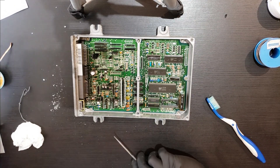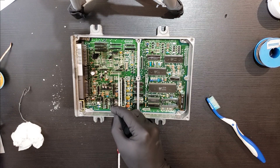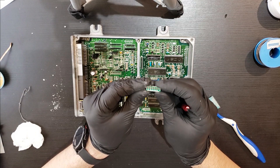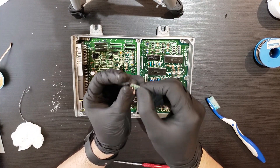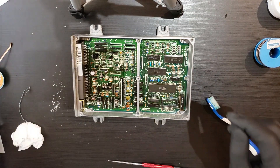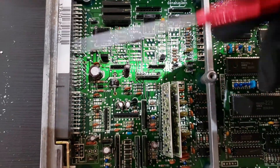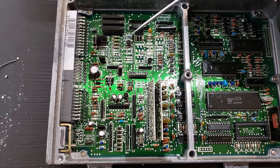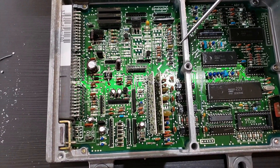Now for the last piece — the RM11 resistor board. From left to right there are three points plus one final point that need to be connected, and the resistor board is also marked one, two, three, and the final point — four points total. This is the first time I've seen one of these resistor boards. It comes with pins, so you install and solder the pins on, then seat the board. There you go — the RM11 resistor pack is installed. So all components are done: D11 diode, IC14 high side switch, R67 resistor, C60 capacitor, J10 jumper, and Q26 transistor.